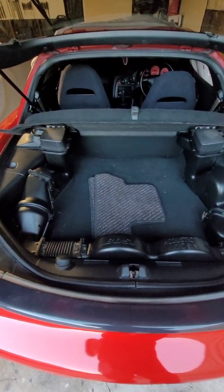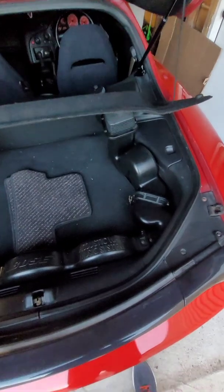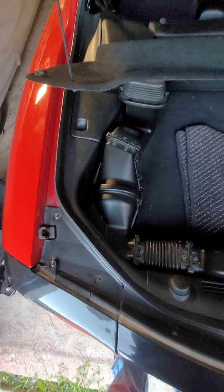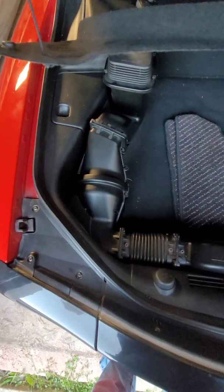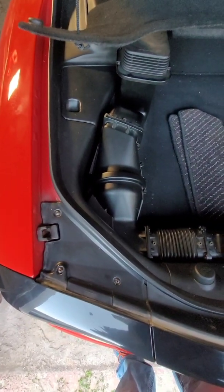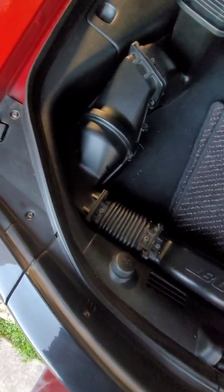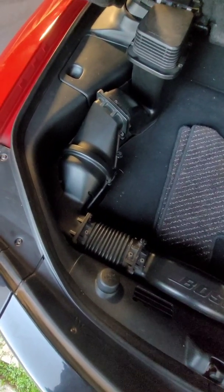All right, so first I'm going to start with taking out the amplifiers for my two subwoofers back here. I'm back here in the big old noodle or worm or whatever that is the Acoustiwave system. The amplifiers are just below the two subwoofers. It's an interesting setup, but the two subwoofers kind of face each other opposingly in that little area there. I'm on the left side of the car right now, and like I said, the amplifiers to those are just underneath. So what I need to do is access those. It shouldn't be hard to do. I think you pretty much just take all these little hex head screws out, and then that cover comes off, and then you can get to it. So I'm going to go ahead and start working on that, and I'll be back in a hot minute.